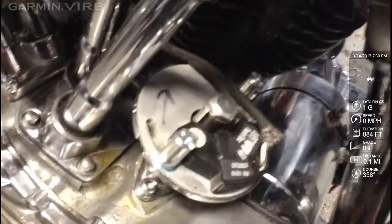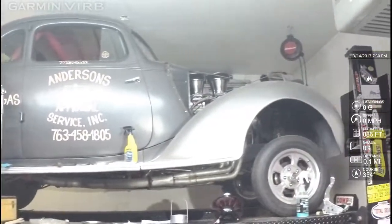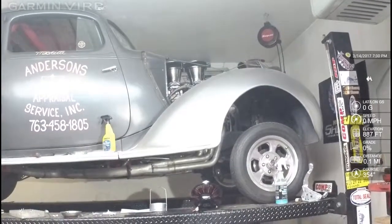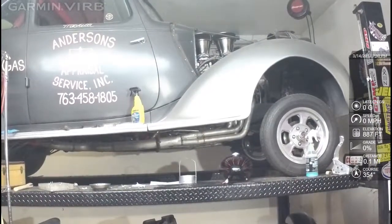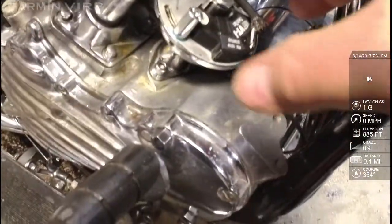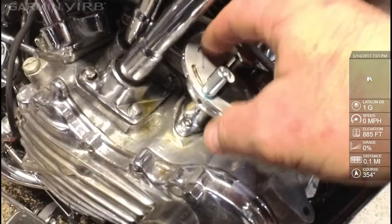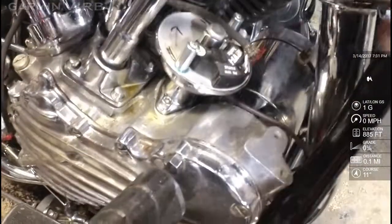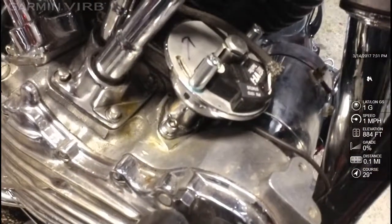I have seen a reference to this on the internet, though I don't know myself if that's true. I can tell you that I run Pontiac engines in my hot rods and they run backwards from a Chevrolet — the gear on the distributor on a Pontiac is on the opposite side of the camshaft. So I think there are two different modes here, and both of them use this pickup, but the weights in this distributor turn it in a clockwise position, and the ones in the cone engine, I believe, turn them in a counterclockwise position.